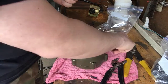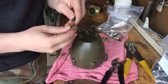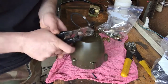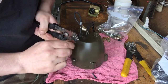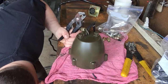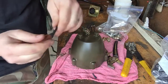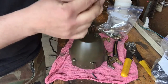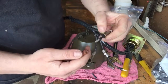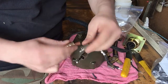The last thing you would do - I don't know if this is the way to do it, but this is what I've been doing. This is supposed to be a quick connect, but once it's on there it'll come off, but it's a real pain. So what I've just been doing is getting this thing on there first. I just gently hold that and take this connector and twist it on until it seats against the rubber boot. You can see it's seated nice against the boot. Then you grab your wiring harness, connect the pins - push that in there, twist it in, make sure it's seated - and this slides up over it and they twist together and you're done.